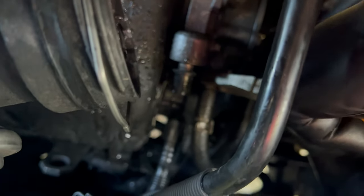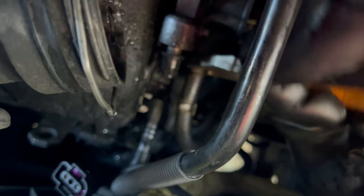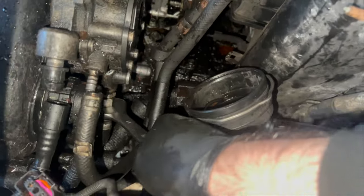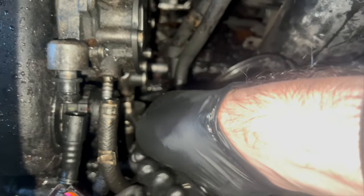Let me know down in the comments if this is the type of thing you do on your drive at home. Even with the hose clip off, this pipe isn't playing ball, so just a little wiggle with a set of pliers to free it off. Time to go with the 17mm and get that fuel line off — and then that's all the lines removed; it's just those three bolts to go. Because we're upside down it means to undo it you're pulling it towards the engine.